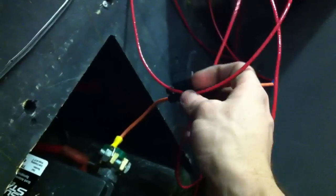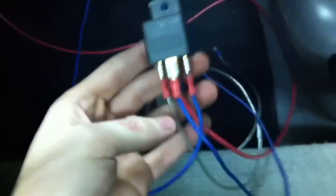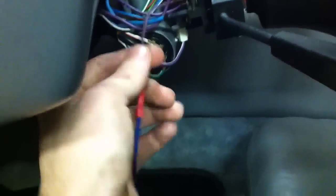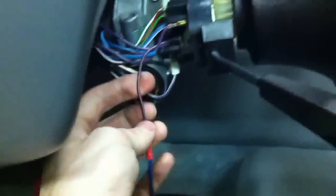The only modifications I had to do were run this 12 volt power cable up to the front of the car to provide 12 volt power to the horns when you need it, and to add this relay to splice into that purple and black cable, and run these blue cables into the relay itself. Lastly, just to ground the relay with this wire. Aside from that, you don't modify anything else. I don't really care about cutting into this wire because it's pretty old — basically rotted on the inside, still metal but the outside is really brittle. I consider splicing into this an improvement.